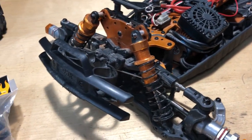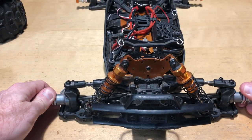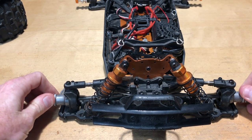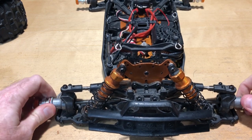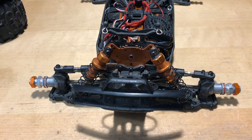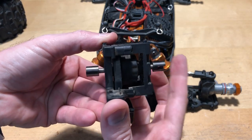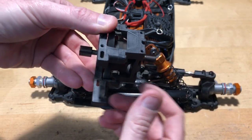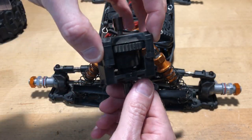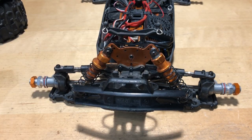I'm going to show you this clicking noise right now. Here's the noise that it's making. I'm sure you can hear that. So that's what's going on — that is the front differential. We did replace the center differential. You can see it's definitely wobbling — this C-cup that's here. They're pretty inexpensive parts anyway.